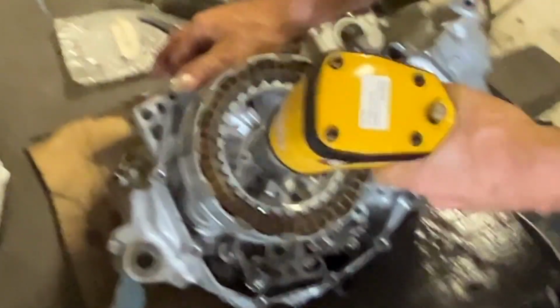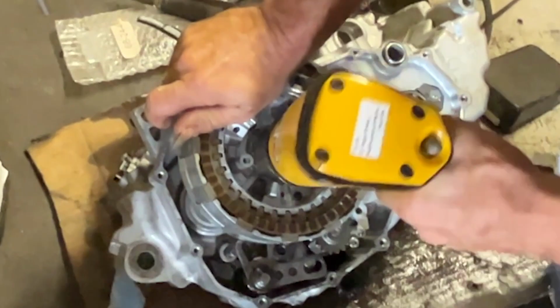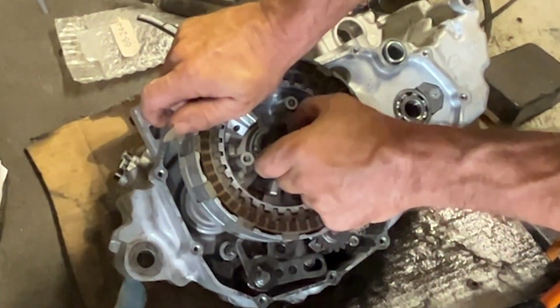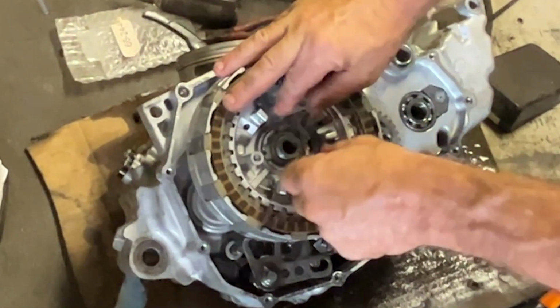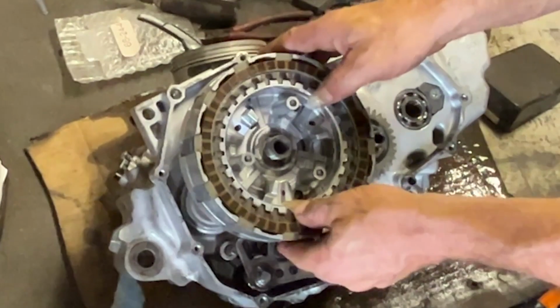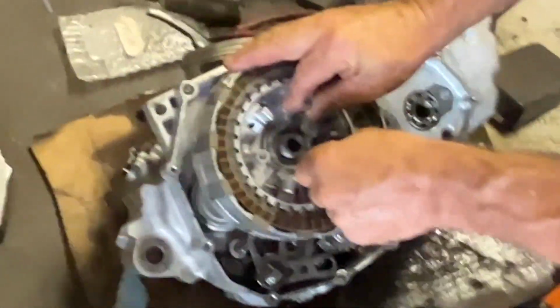Those little rubber bumpers I can see being problematic. But again, until I see a service bulletin from Yamaha, I'm just thinking that some people don't know how to ride or they got faulty products. Either way, there's a fix for it. Put an older basket in it. Get an aftermarket basket. Get rid of this 3-bolt basket.